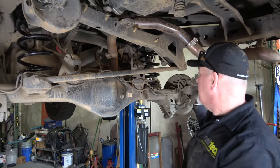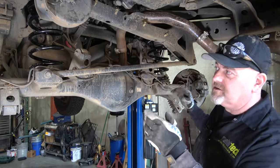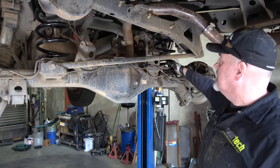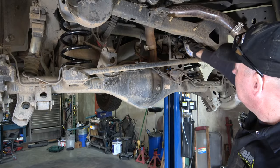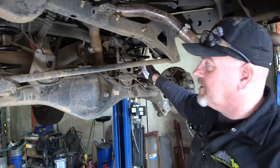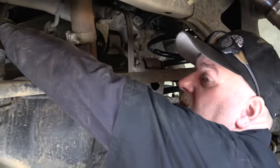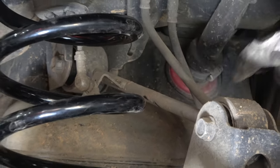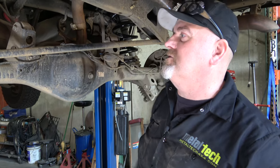So we just finished everything. We got the shocks back on, connected to the frame. We got the sway bar connected back to the frame. I've re-torqued down the passenger side and the driver's side is completely done. I've verified that the pigtails of the springs are sitting in the proper pigtail seats, springs are sitting in the proper seats up above, and we have the upper isolators — or secondary springs as Toyota calls them — those cone things in the top. Those are in place and fully operational. I can see that the ABS lines are all looking nice and healthy. I'm going to make a recommendation to this customer that extended brake lines would be a good idea — the rear brake lines are looking a little stretched out. At full droop they're okay right now, but over time it is a good idea to change those out.